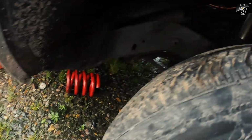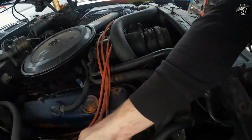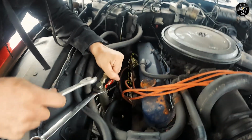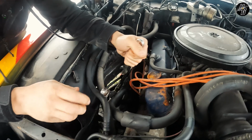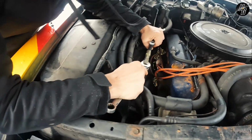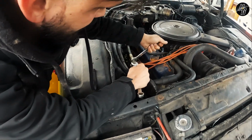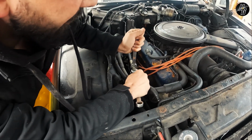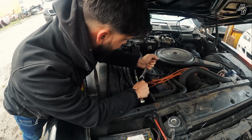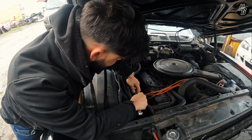There we go. Right, now what we're going to do is use our spanners. If you hold that, that's it, Dave, to crack off that. So 19 on there. Be careful, Dave, because this is hydraulic pressure, and although we know there's no oil in it, there could still be a bit of pressure. I'm just going to give it a little crack. Okay, no pressure at all. That's fantastic, because we know there's a leak, so we had a high chance of there not being any pressure. Realistically, I should have been wearing goggles, to be absolutely frank. So there we go.